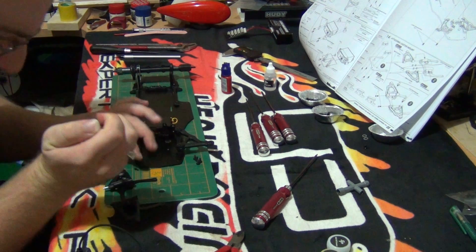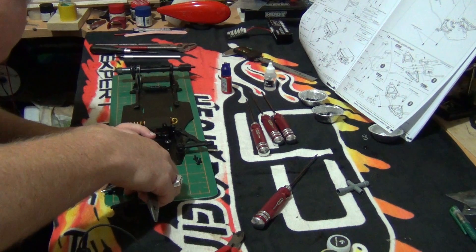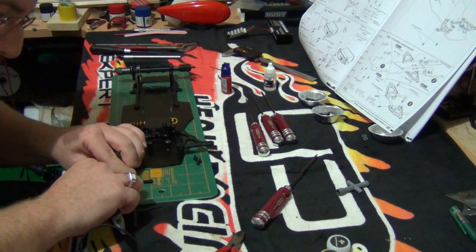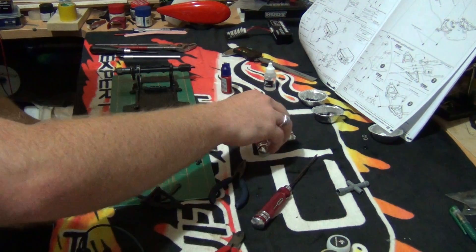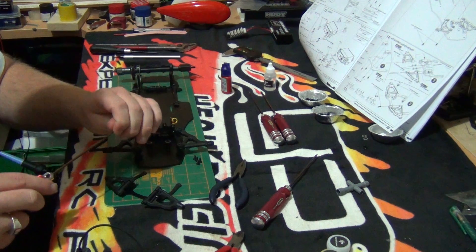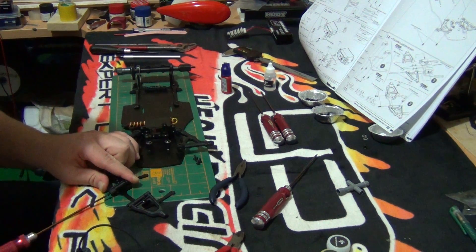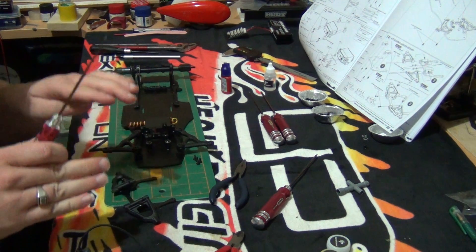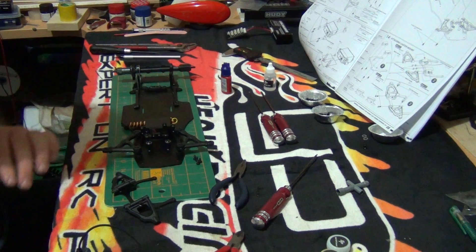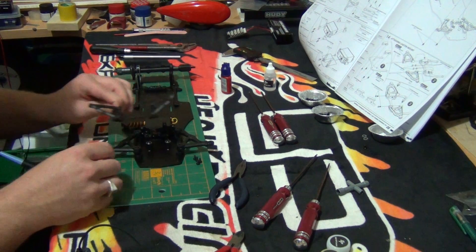You might need to get some pliers — this makes it not so cumbersome. Now it's slotted in, so we just push it in all the way. With our 1.5 millimeter driver, what this screw does is it prevents the pin from coming out. Same deal as always — not over-tight, but you don't want the pin to slowly work its way out as the suspension arms are moving.